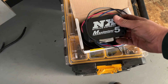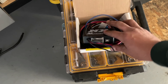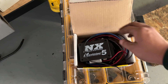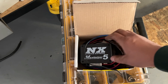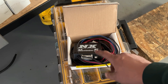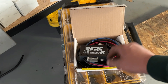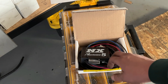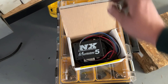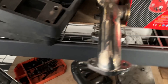One of the things you can do is get a progressive nitrous controller. This is the Maximizer 5 from Nitrous Express — it comes with everything you need to hook it up. You can also get it in a kit with two solenoids, bottles, and a harness. It has an optional screen plug-in, and you're able to control two solenoids, with add-ons to do up to four total. Really easy to use and I really like it.